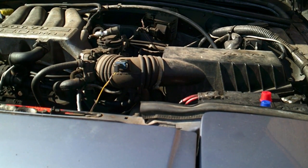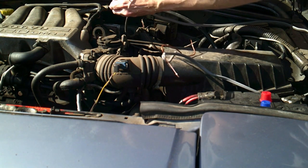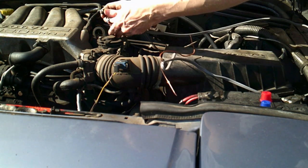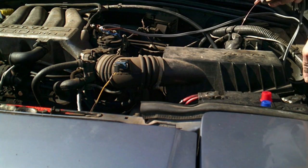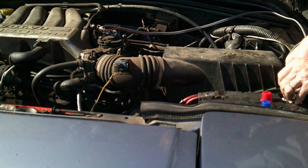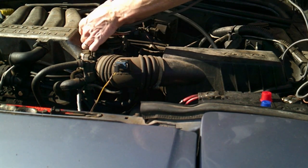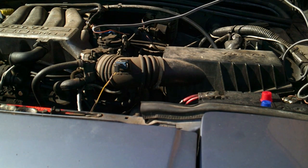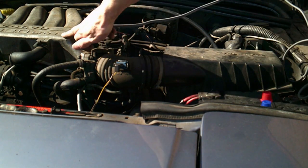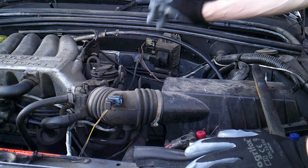I tend to use a bit of wire and ground it on the negative of the battery terminal. It's going to be difficult because it's a sunny day, but generally that's how I'd go about testing - using a known good ground connection, because the body of the engine isn't in the best of shape clean-wise. So we need to work out how I can look for the spark whilst turning it over. Back after testing - and we're not getting a spark from the main output of the ignition coil.